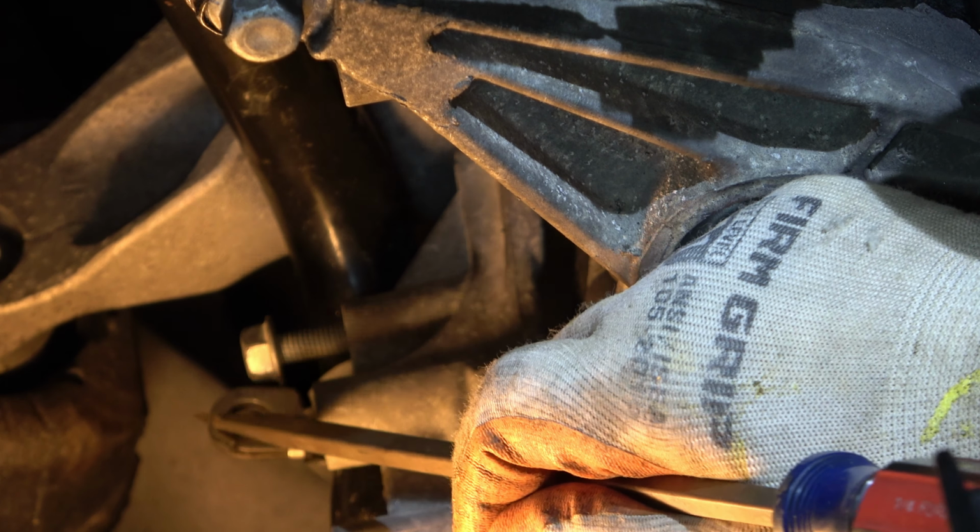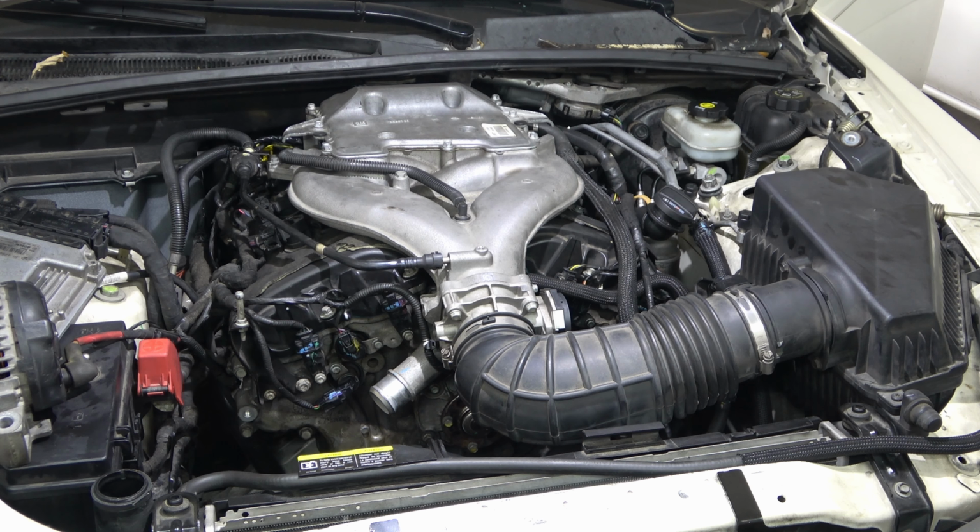Most modern cars have a feature. When you push the gas pedal through the floor, it disengages the fuel circuitry. So I'll crank the engine over and let the oil pressure build. And then when I release the pedal, we should have ignition. Found the culprit, had a vacuum line off. That engine was taken off, man.